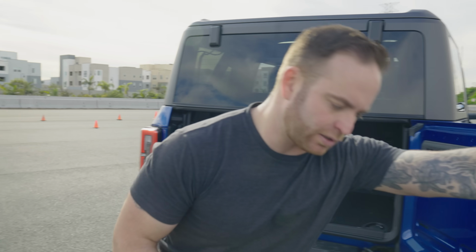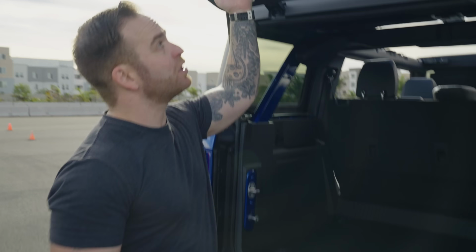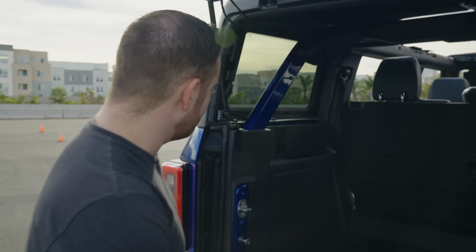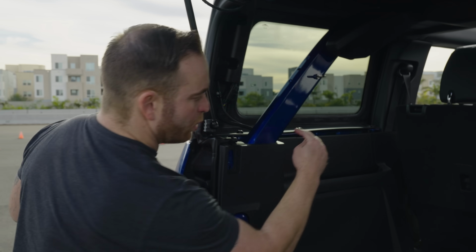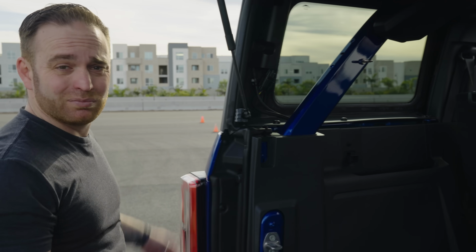Got to open the tailgate all the way and open the glass. And you want to leave the glass open when you take the top off because you don't want this bottom part hitting the ground. And they're basically a series of bolts along here and along the other side, 4 of them that you take out, and then this whole thing will lift right off.